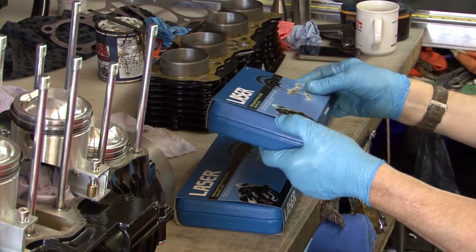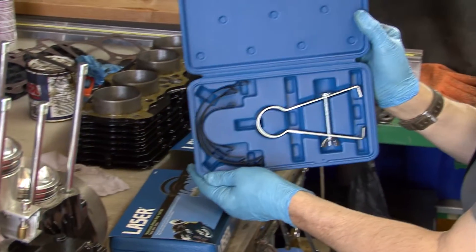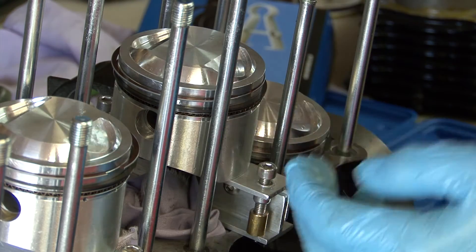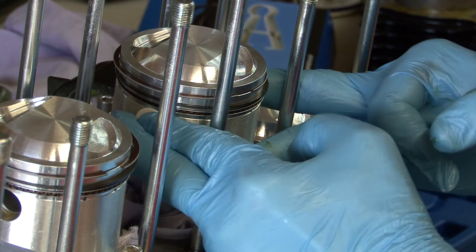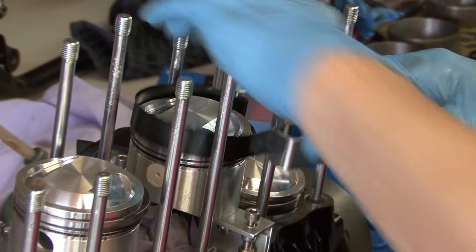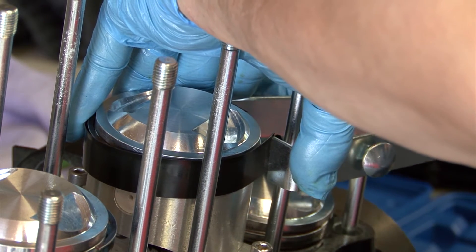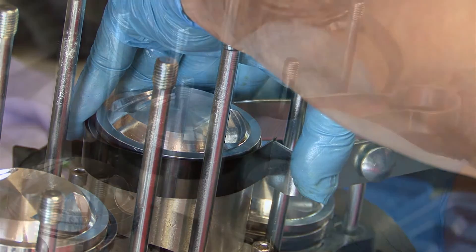Fitting barrels especially to multi-cylinder bike engines can be a real headache, but these ring clamps make it so much easier. Most gudgeon pins are held in place by wire circlips but these racing pistons use teflon buttons instead. Select the correct size of band for the ring compressor tool and pre-assemble it, then loosely slide it over the piston and rings with the flanged out section of the band uppermost. Then do up the wing nut compressing the rings into their grooves, ensuring that the top ring is just below the flange of the band.